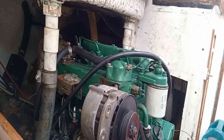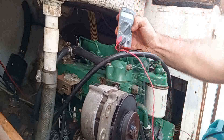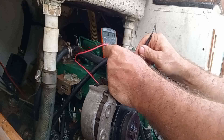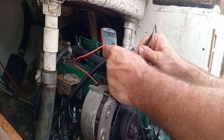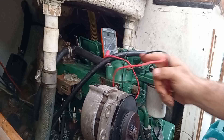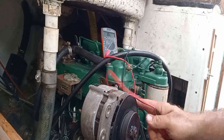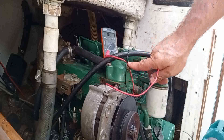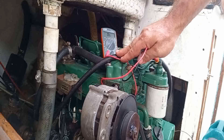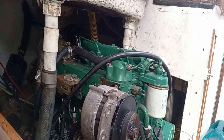What I've done previously — you can do this yourself or just trust me — you can take the measurement of the front of this. The back reads around two point five kilohms, something in that range, and you'll see that it actually changes according to the temperature of the engine. The engine is cold at this stage. I started the engine, let it run until it was warm, and as it cooled down I could see the resistance change accordingly.